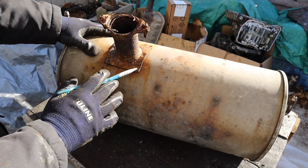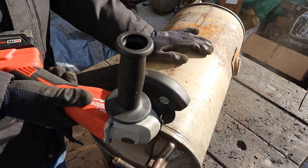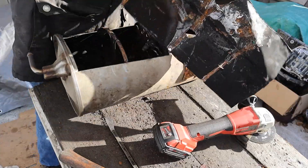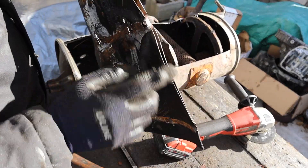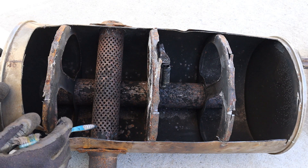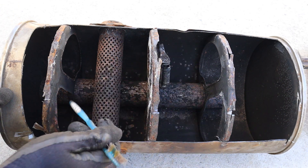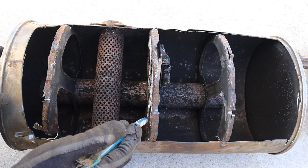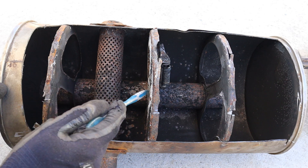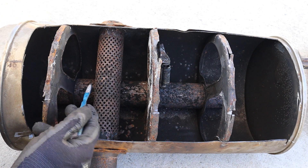This is supposed to be the inlet — it looks like it's been patched over here because that was supposed to be the inlet but in fact the outlet is on this side. This is a double layer and it's spot-welded in these locations to the baffle. Taking a look at this Toyota muffler, the input comes into this pipe which has lots of perforations inside, and that's going to fill up this entire rear section. These supports are actually not really baffles — they're just there for structural support with big holes in them anyway. The rear chamber fills up with exhaust gases and the sound starts canceling each other out as it moves between the rear plate and the middle baffle. The outlet pipe running crossways has a few little perforations in it, so there is a chance some exhaust gases can take a short circuit and exit straight out the tailpipe.